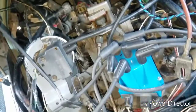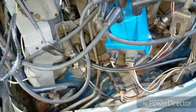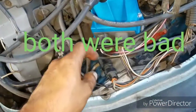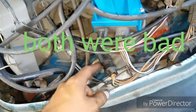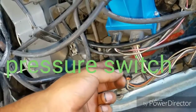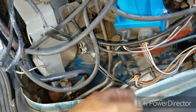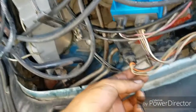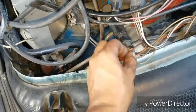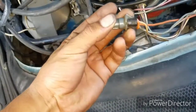To make a long story short, I'm pretty sure in this vehicle it's not the distributor module itself — it's actually going to be its buddy here: the oil pressure sensor. This one goes to the computer. What happens is it has poor connection — the wires are not frayed or broken, even though they are a little tangled.